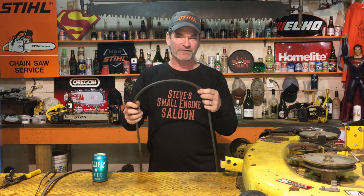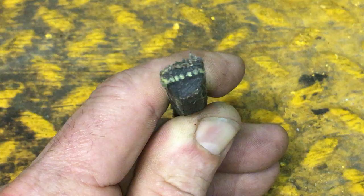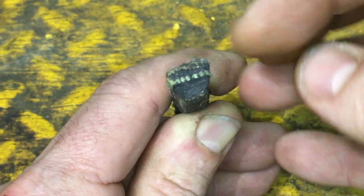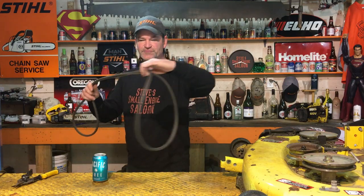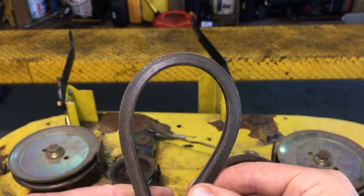Now we're ready to put that belt on — you've got a brand new belt. Here's something a lot of people don't consider: sometimes these belts get shipped to you inside out. There are two sides to a belt — there's a flat side and there's a V side. I'm gonna cut this old one right here so you can see a cross section. You can clearly see the shape of the belt when it's cut in half. When you have that new belt in a loop, make a hundred percent sure the V is on the inside and the flat side is on the outside. If you have it inside out, there's no chance you're getting it on properly.